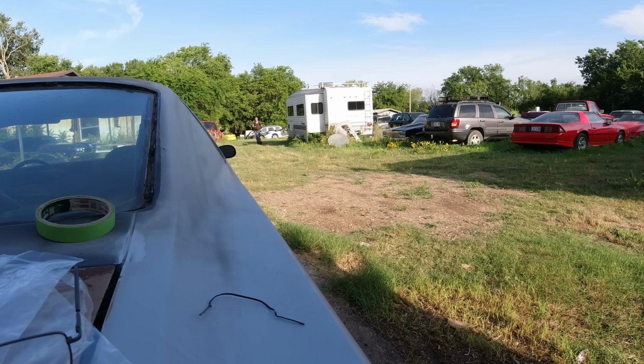Okay, I started stripping this car down. Got the weather strip and the belt molding off. We'll have to put a little rust treatment right in that edge there. I started chipping away the old caulking. But anyway, she's sanded down. I was doing it in the dark last night, but I'll go over it again. Same with these spots here, these parts. They're pretty rough, but I'm not going to be sanding overboard and try to make it perfectly smooth. So if they look kind of shitty, I think it's in behind the bumper anyway. Okay, I'll get some primer and paint on these when I go over it one more time here in the light. Make sure I got it all sanded. Okay, I'll be back. Okay, guys.